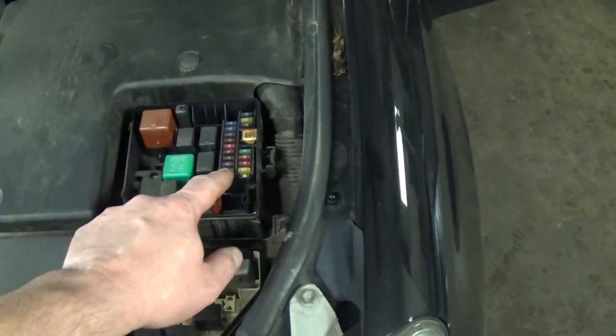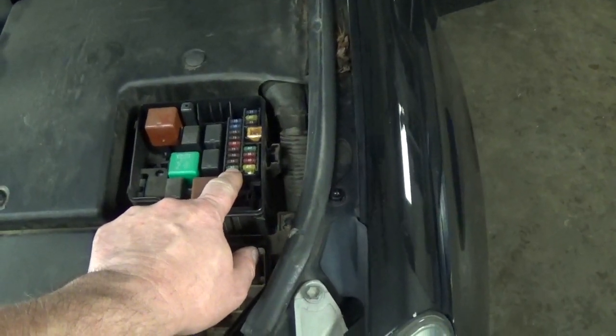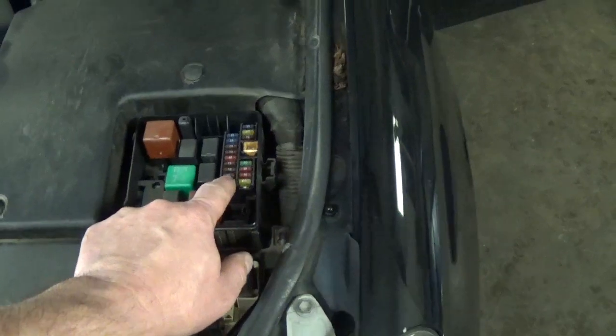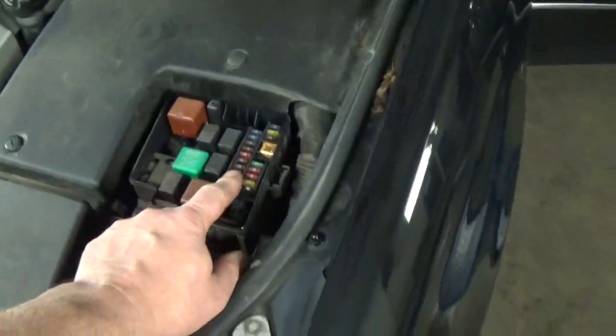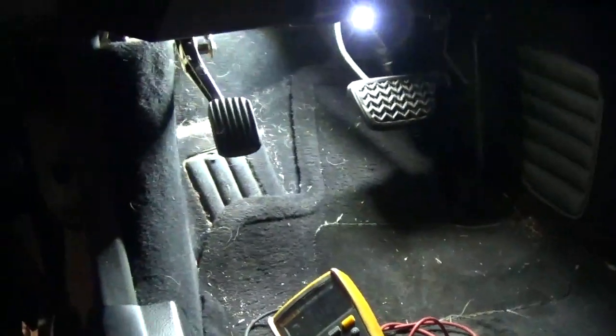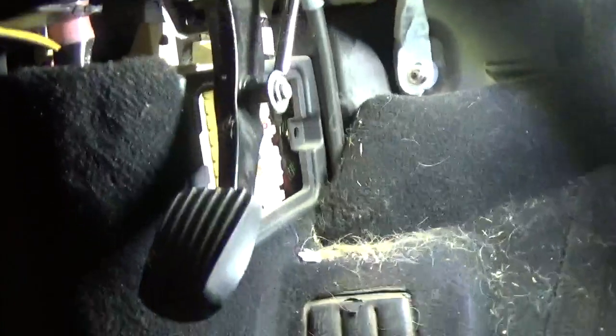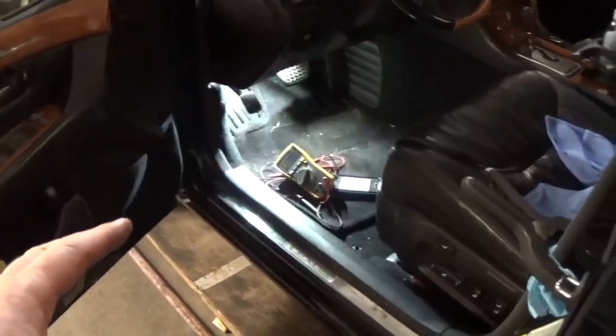So once you find the fuse or the circuit where you have a small voltage drop across the fuse, that circuit is alive. So I have checked this and I couldn't find anything. Then I went to this fuse box here. There are some fuses there, you can see the fuse box. Now, in order to access your car, the car has to be asleep.